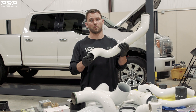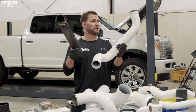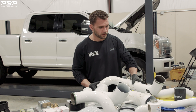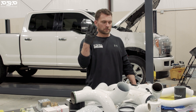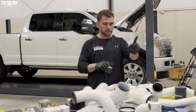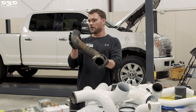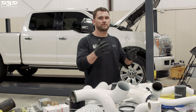This is the good one — the component that keeps the family from being stranded on the side of the road. This right here is buckled up and ready for war — three-inch all the way from the intercooler pipe up to the Y bridge. Are you going to trust a rubber boot on the dyno when it blows? No brainer. The last and most crucial component — the throttle valve adapter. We do not use a throttle valve adapter; instead we use a five-ply silicone boot to attach all connections, along with a Vibrant clamp on top. Five-ply versus one or two ply from the factory — that's the biggest difference from factory to the F2 HP package.